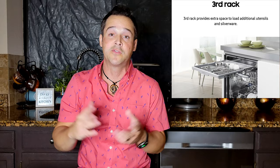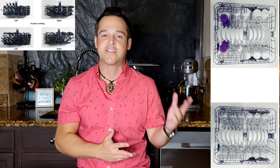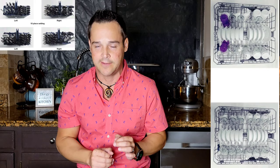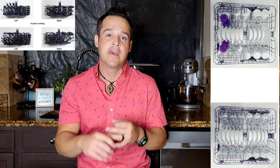It gets off hard caked food. It gets into those spots — if your bowls are leaned over it still seems to get the top great, and the bottom nice and clean. One thing you have to be careful of is sticking long wooden spoons and spatulas into the silverware area — it will stop that top blade from spinning. If you make sure that's done right, even when you overstuff, this does a great job. Hard water doesn't help anybody — a water softener is usually a must in a house, and if you don't have one definitely use some sort of rinse aid, otherwise you're going to have spotty glasses that a dishwasher can't fix.